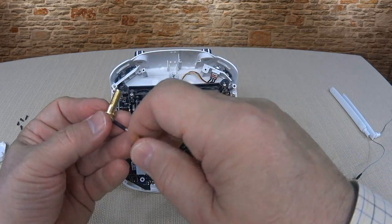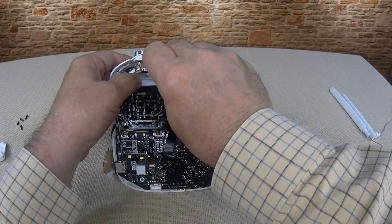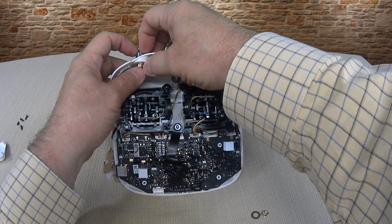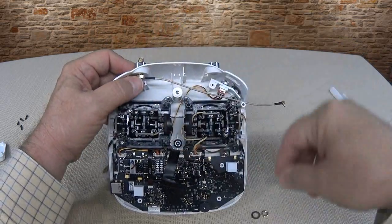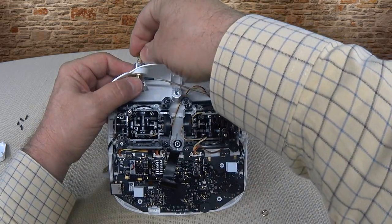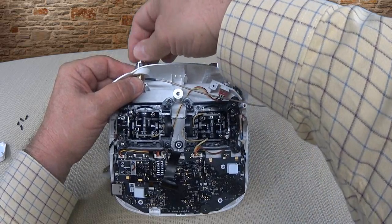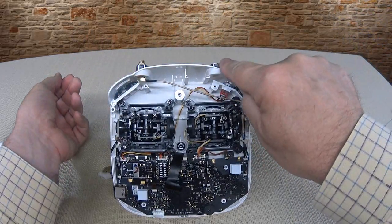And the way you want to put this thing together is you want to slide this through the shaft till it's up top. Put the bushing in from up top and center it, and it'll slide down in the shaft. And that keeps it from rattling around inside the shaft. Then I'll put a washer on top of it. I'll put a nut on top of that, and I'll finger tighten it. So once that's finger tight, we're good to go. Then I'll do the second one.